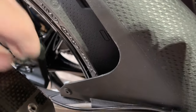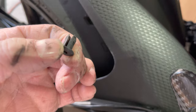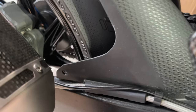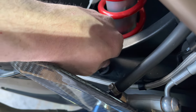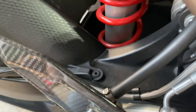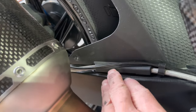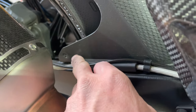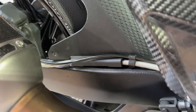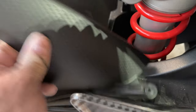That little bolt is out now — this one just pushes out like so. Same thing with this one: I got it loose enough where I'm going by hand. You want to pay attention to how this is with the brake line, because when you reinstall it you're going to want to install it the same exact way.